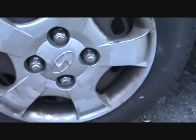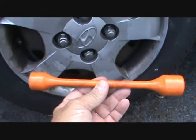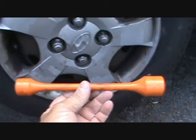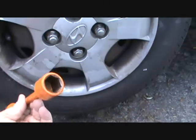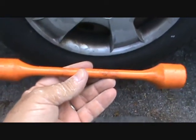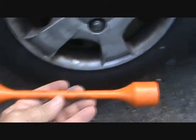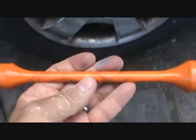I've got both wheels on. What I'm going to be using to tighten the wheels is what's called a torque stick. They're calibrated by how big a diameter they are and they're also color coded. An orange one is 80 pound-feet of torque, and the business end is 21 millimeter. For this car it needs to be torqued at 80 pound-feet. To make it easier I'm just using an impact with a torque stick. The way they work is the impact tightens by hammering, and when it gets to its designed torque, the thing just flexes and it won't tighten anymore. That's how it works.